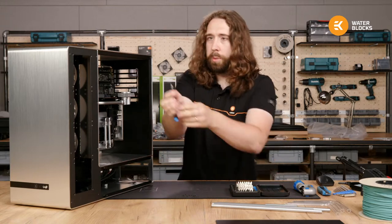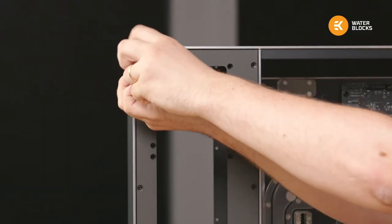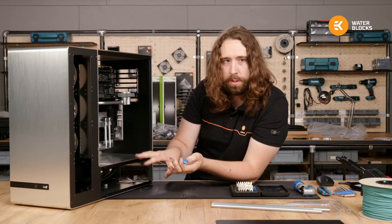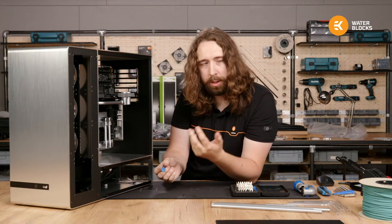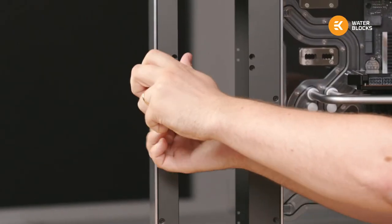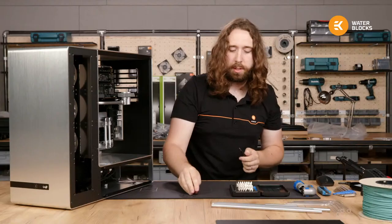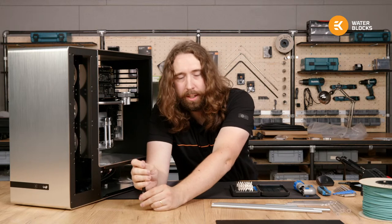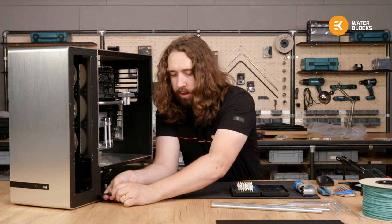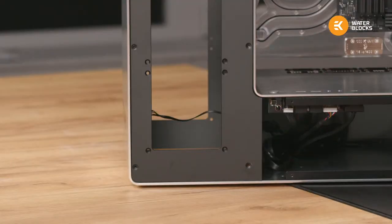So I think the first thing I'll be doing when I've got this apart is to fit the pumps. They go in the base of the case in front of the power supply, and from there I will make the cables specifically for the pumps. I'm not going to have any connections, so I won't have any Molex cables or anything like that, but I'll wire everything directly to the power supply. I also won't have any controllers, any fan controllers, any light controllers. That's just the way I like to do things, so it can be super clean and absolutely zero software, nothing adaptable, because I don't like to hear that the fans are changing speed. So if they're a constant speed, that's absolutely fine. With two 480s in this case, there's really no reason that they should ever need to ramp up.